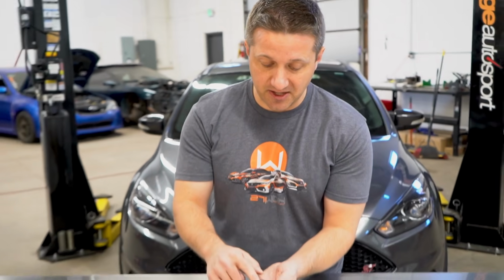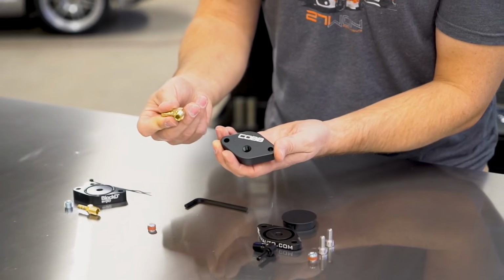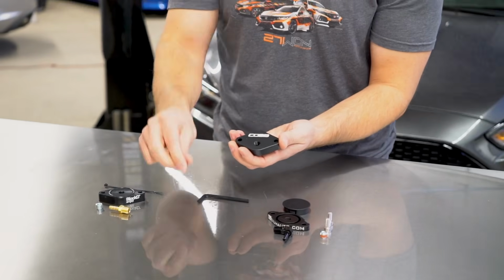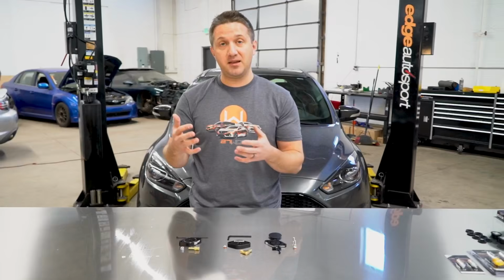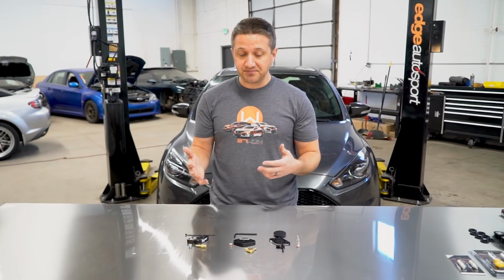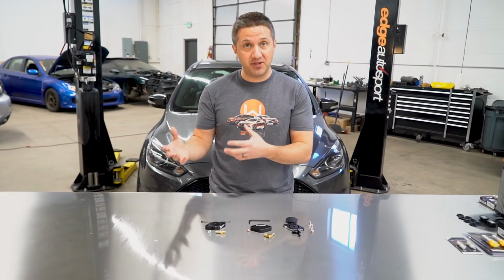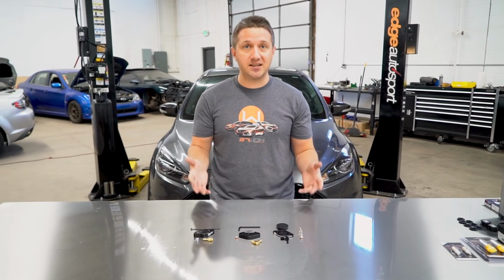You can see in the center of the plate, there is a tap for either a fitting or a plug. So you can plug it if you don't have a reason to use it. The reason why you would need to use a fitting is if you put on a big turbo, or not necessarily just a big turbo, if you want an external blow-off valve, a mechanical activated blow-off valve, like the CPE Exhale kit or the JBR HKS and Tial atmospheric blow-off valve kits. These are the vacuum and boost source for those blow-off valves, or at least it's the easiest way to do it.